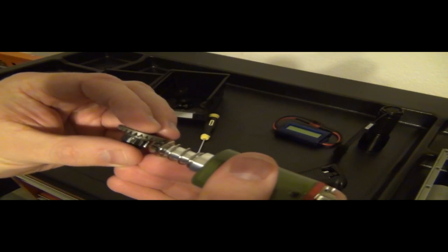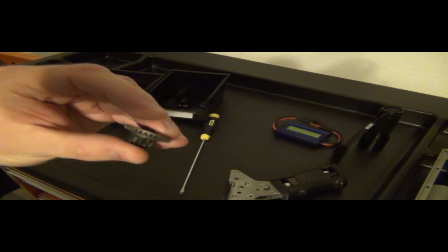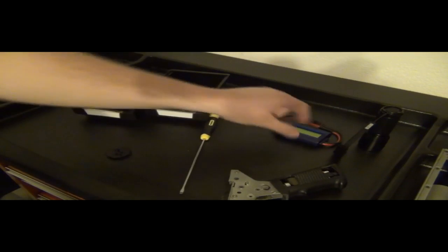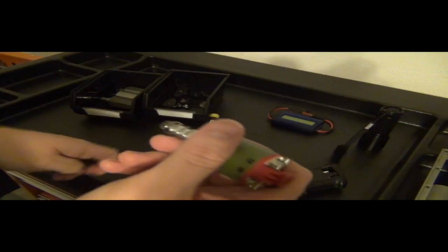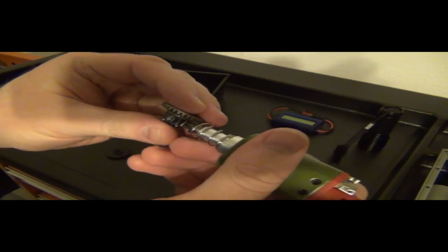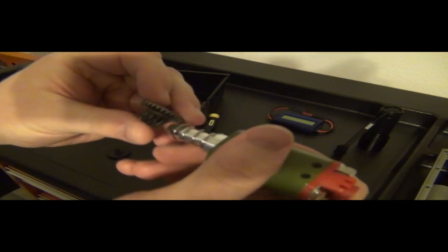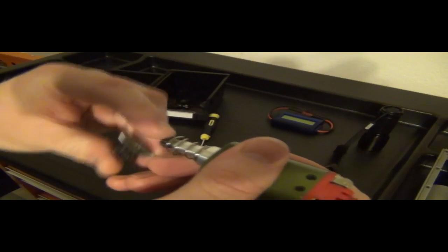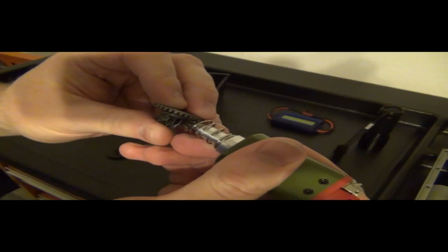Okay, it's going to look parallel, but when you shoot it, not only is it going to have that mechanical resistance, it's going to show it on your amperage on your watt meter, but you can feel it. If you were to use the screwdriver test that I was showing earlier, you could feel this gear could not turn very well because it's bounded by this gear, this pinion gear. It's bounded, it's held tight, it's being pressurized.